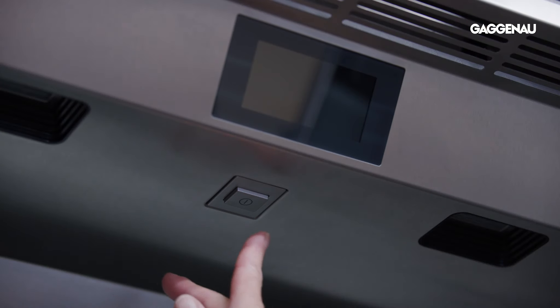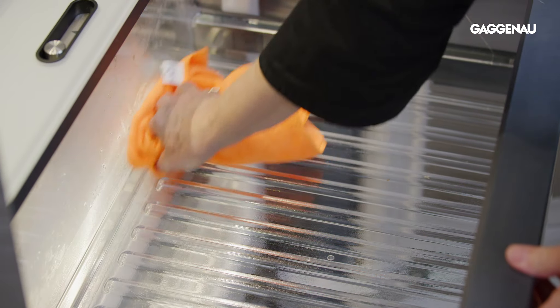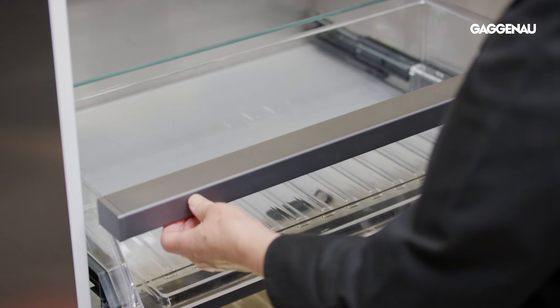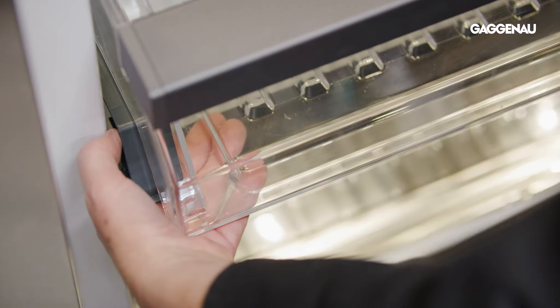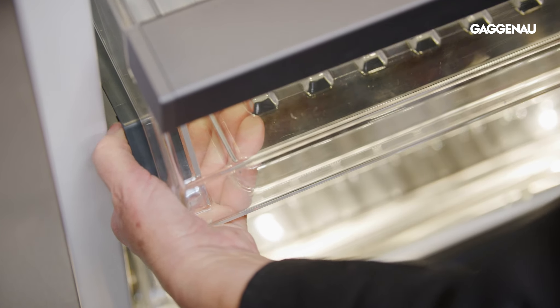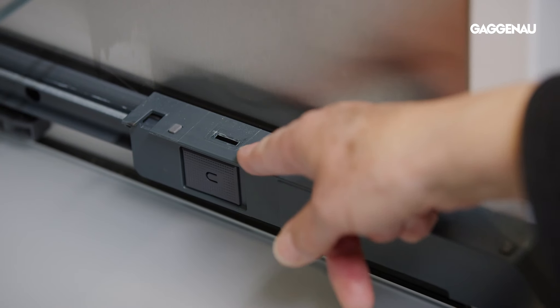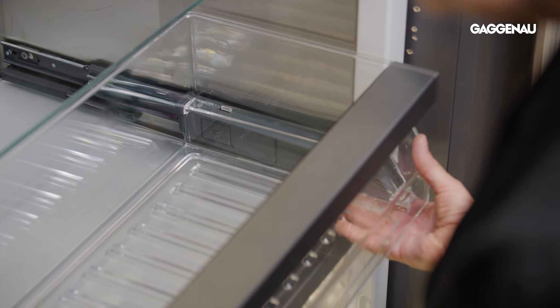If required, food can be removed from the refrigerator and the unit turned off for a thorough cleaning. Use warm soapy water with a mild dish detergent and rinse with clean water. The door bins, rubber mats, storage bins, and glass shelves can be washed by hand in the sink, but no items should be washed in the dishwasher. To remove a drawer bin, fully extend the bin, place your thumbs behind the triangular plastic piece on either side with your hands under the drawer, press in with your thumbs and push up to remove. When replacing the drawer, make sure the plastic tabs at the rear snap into the slots at the rear of the rails.